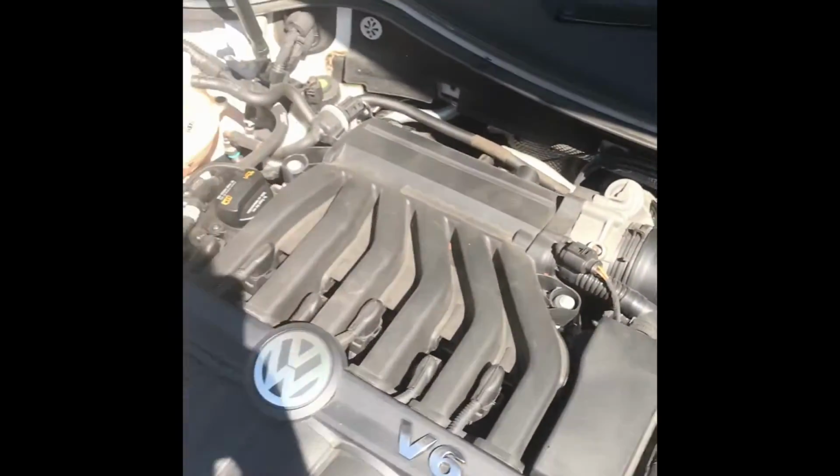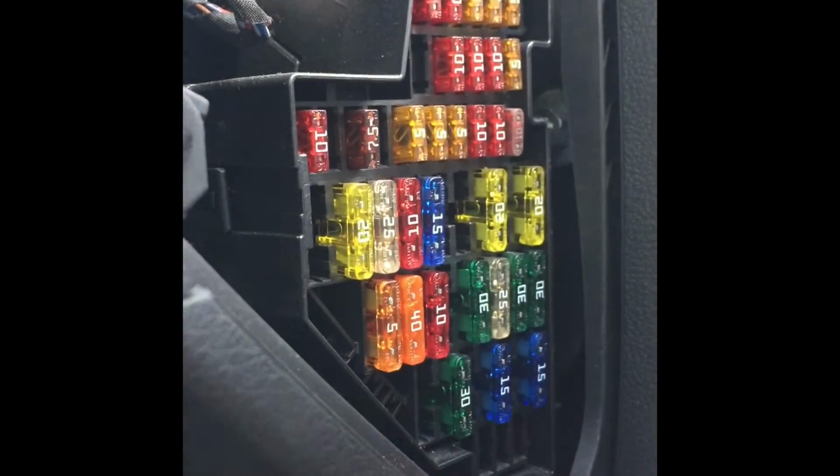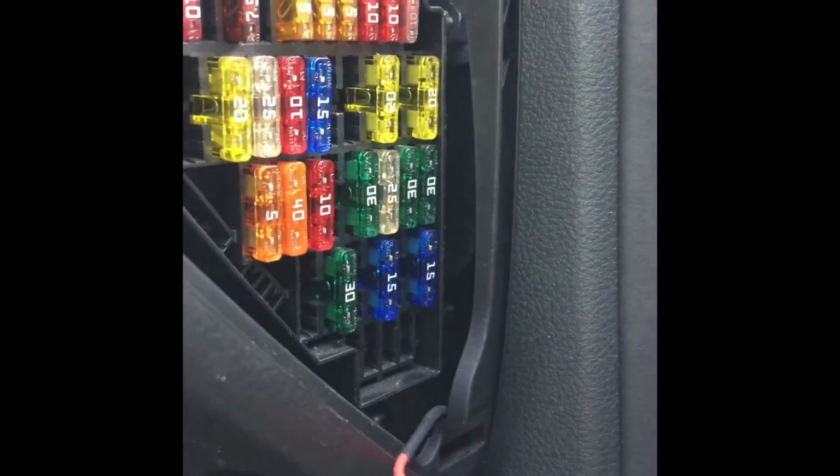So now it's just about doing the crimping of the fuse wire. I guess join the fuse tap to the red wire from the DRLs using a crimping tool. So pretty straightforward. The red goes into the blue, and a set of these. Pretty simple. Crimp down. So I've run the wire through there. I'm going to neaten it up. There's a few gaps here, and then into the fuse box.